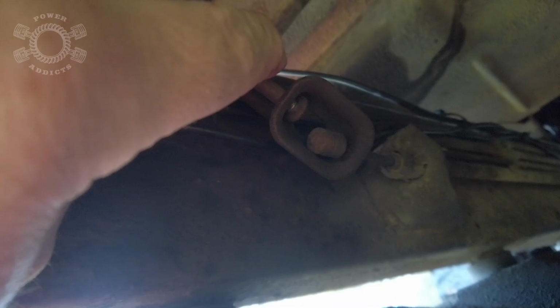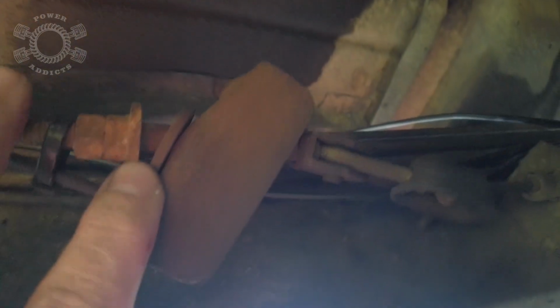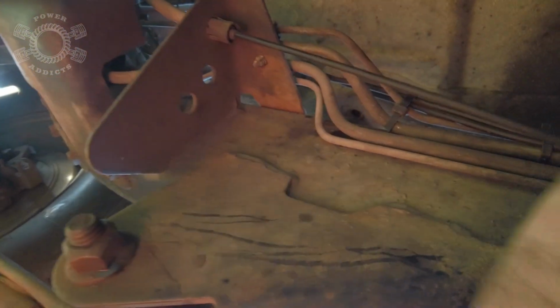But here's the cable that goes to the body. So it comes off here, runs up through there, and goes into right here. Notice, it joins the frame. So, with old crusty YJ stuff, as crusty as it is, there was potential ground points coming all through here, coming off the body onto the frame. So the current was coming through the winch here, cycling into the e-brake cable, then going through the body. But the body had a ground, because you remember that old ring that's on the side of the block? Right there.